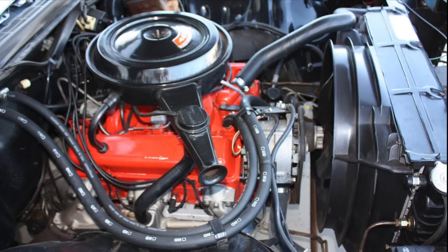It wouldn't be until 1974 that a four-barrel carburetor could be fitted atop the 400 cubic inch V8. Interestingly, by the time the four-barrel arrived in 1974, the engine had undergone modifications that made the internals somewhat weaker. Specifically, only the 1970 to 1972 400 cubic inch V8s had four-bolt mains; after those model years, the 400s had two-bolt mains. Chevrolet likely decided this was acceptable since the 400 was never intended as a high-RPM engine and was always oriented toward torque over horsepower.